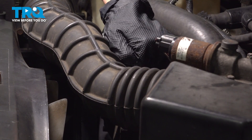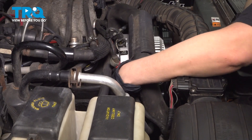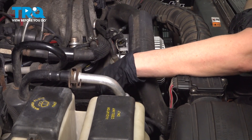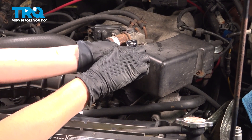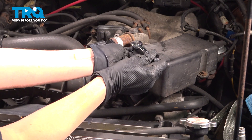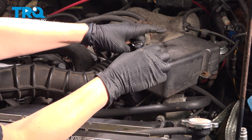You're going to take out this hose for your air box. Take this harness bracket out of the alternator bracket. Using an 8-millimeter socket, we're going to take off our air box. This should get it out of the way.